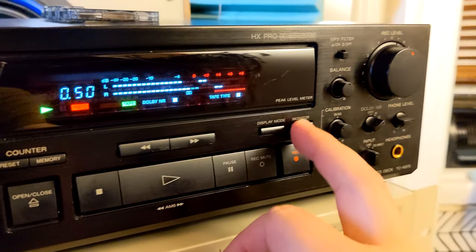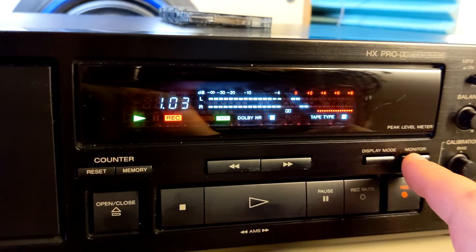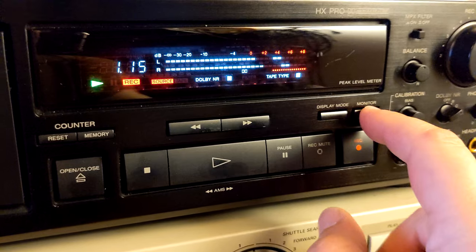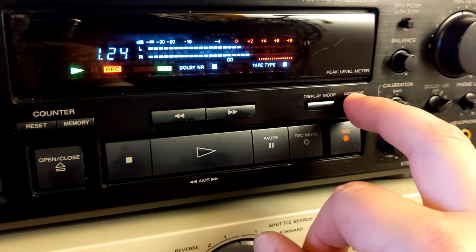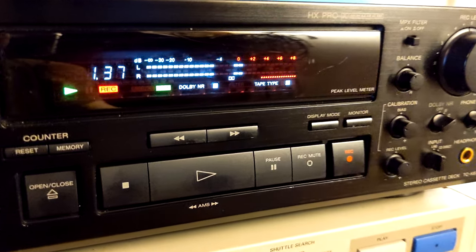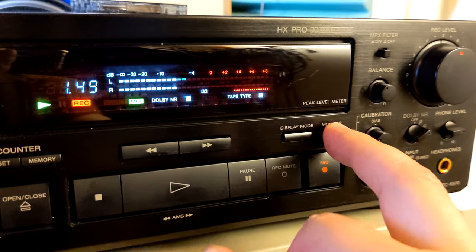Tape here, we're gonna bring the level a little bit up. This tape is old, I'm not familiar with it — is it good enough? But it's still recording. A little bit more high than source, I'm gonna put bias a little bit on the left. Okay, let's do it like this, I'm not gonna go too much. Yeah, I like it like this. And here you can of course adjust your balance because you're using a line input, so we can even it up. Even if it's different on the source, I like it even on the tape.